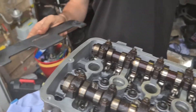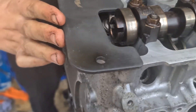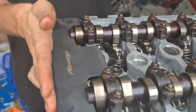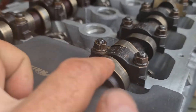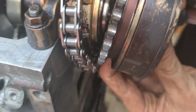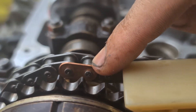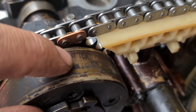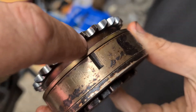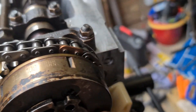Now we've got to make sure that the cams are at TDC. We've got the cam alignment tool here and there are two notches on either cam — they've got to be aligned. You also want to make sure that the inlet and exhaust cams are almost pointing at each other. There's a little scribed arrow that points to the tooth. The dowels mean it can only go on in one way, and that lines up perfectly with the middle of the copper link. You've got your scribe there which goes through the tooth, which is perfectly in line — and the scribed arrow on the other cam lines up with the tooth, which needs to line up with the copper link.